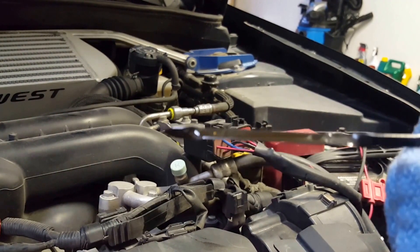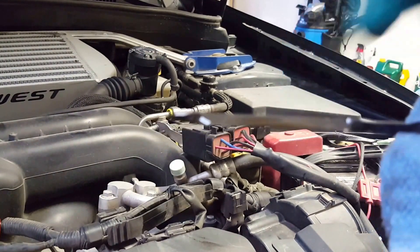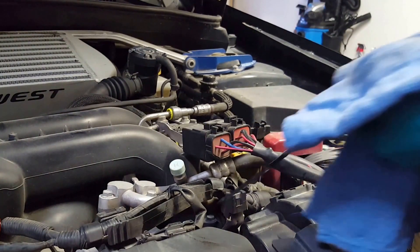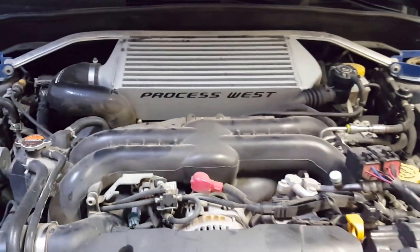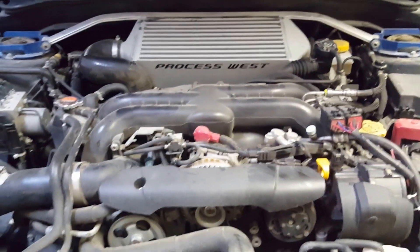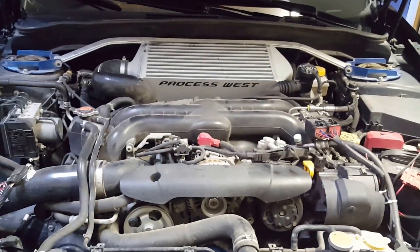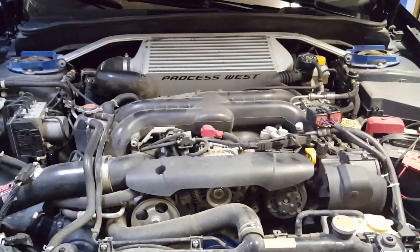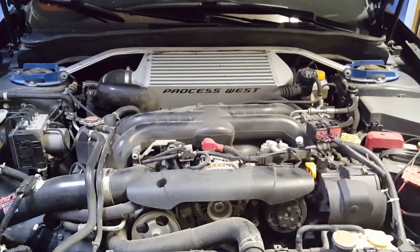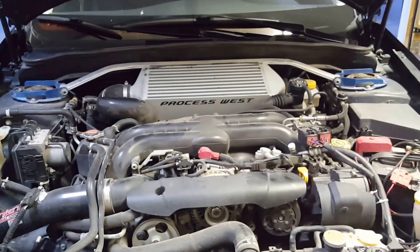Now that the car is driven off the ramps and level, we can check the oil level. You want to have the oil at the second dot at the full mark. After that, all you have left is to make sure you put in the two clips for the skid plate on the left and right side of the wheel wells, if you had a skid plate installed. Clean up and enjoy the rest of your day. Thanks for watching guys — if you liked what you saw, please subscribe. If you have any questions or comments, don't be scared to comment below. Thanks!